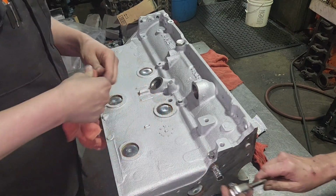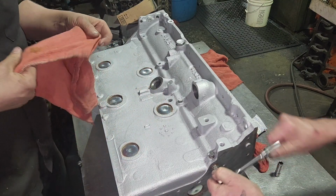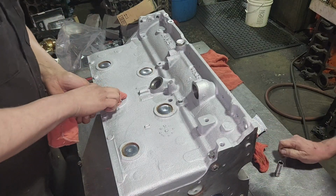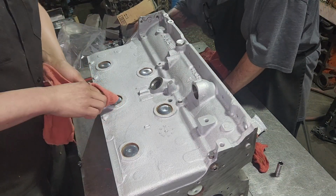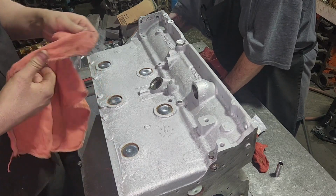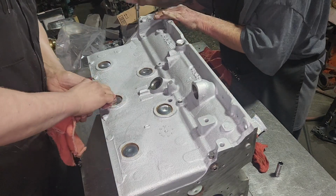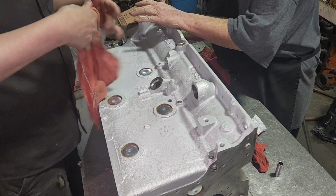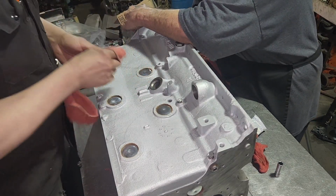These have to be nice and snug. You don't want any oil leaks. It might have oil leaks anyway. You know, these have a road draft tube. Instead of a PCV valve, it just lets oil out on the ground. Look at old 1950s television shows when the cars are driving down the roads. There's a big streak right in the middle where the engine just dumped its oil and oiled that road. Now they restrict us from dumping it on the ground, then they send somebody out and pay them to do it. Doesn't make a lot of sense, does it?